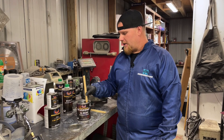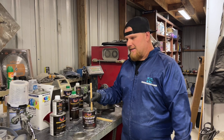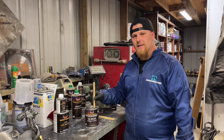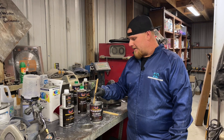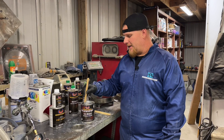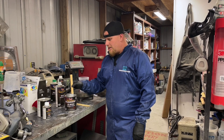It is always good to go through these steps in any metallic color. If you're spraying an entire car, I like to mix all the paint in one container — maybe not all the same day — but pre-reduced to what I like, kept in a brand new gallon jug. It is important to document temperatures, mix ratios, all that stuff, and definitely go off a TDS sheet on all the paint you're mixing to know the mix ratio and your flash times.